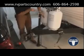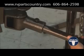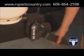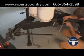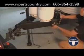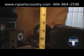Couple the trailer to the hitch head by placing the trailer coupler onto the hitch ball. Reinsert the spring bar assembly. Release the rotating latch bracket by rotating the lock pin. Rotate the bracket using the wrench provided and turn clockwise until the chain slot is on the bottom. Use chain length 10 again. Repeat on the other side. Apply weight to the towing vehicle. Measure coupler height — the coupler height is now 26 inches.